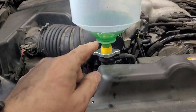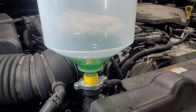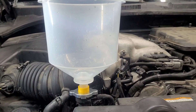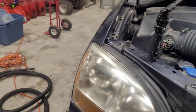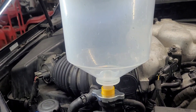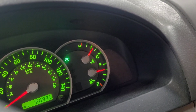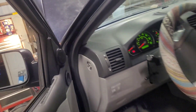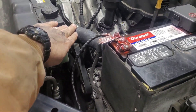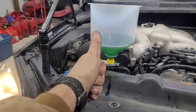After another five minutes it finally quit bubbling, so it's time to start it up. Once I started it, it began bubbling a little bit more — more going into the motor now that it's heating up. As you can see it went empty again, so we continued. Now the Kia is pretty much at operating temperature, the radiator hoses are warm which means the thermostat has opened. I've filled it and it is no longer burping, so I would say it is full.